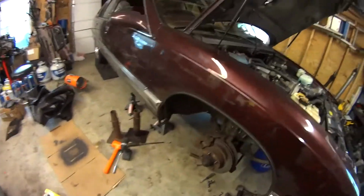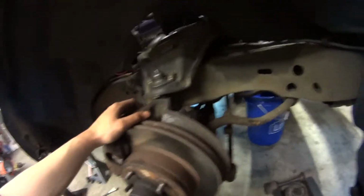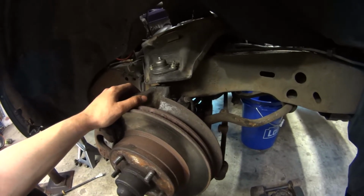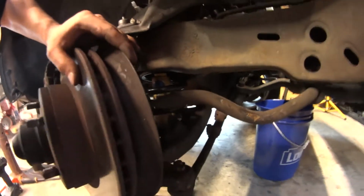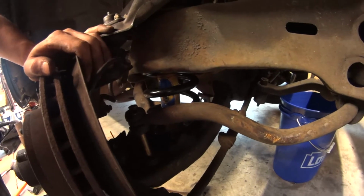The other thing that I did do that I don't think I got on camera before is I found the source of the clunk on the front right. I know in the first test drive the front left was clunking pretty badly because the front left spring was way out in how it was seated. Well, I found out that the front right wasn't really seated well either, and it was rubbing against the spring pocket. I don't know if you can really see it, but there's this little lip back here that runs along the back edge, and it looked like how it was seated in the lower control arm, the spring was cocked in a way where it was rubbing against that.